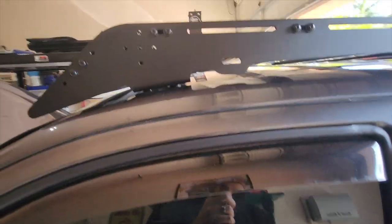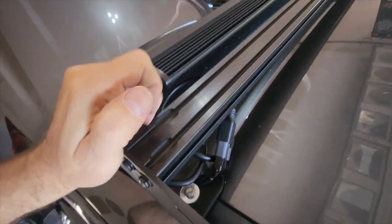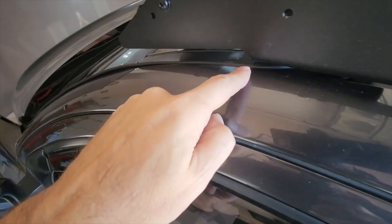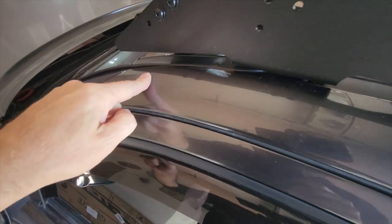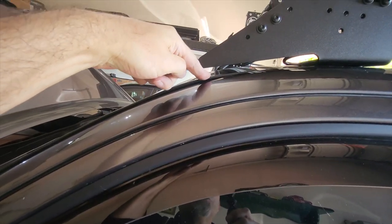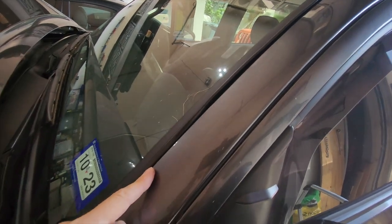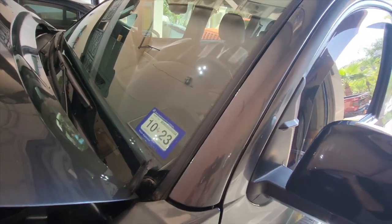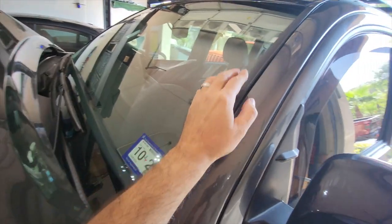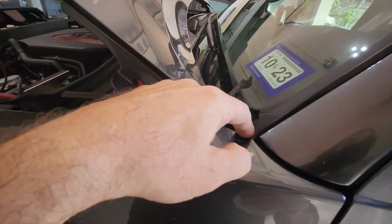As far as the wiring up here on top, I've plugged in the light bar into the wiring that's going to run into the cab, then ran it through one of the holes on the rack to line it up along the edge of the truck, keeping it hidden. From down here once it's tucked in you won't even see it. I'm going to tuck it into this groove — I'm hoping friction alone will hold it, but if needed I'll put some caulk behind it to freeze it into place.